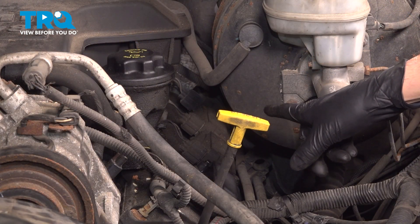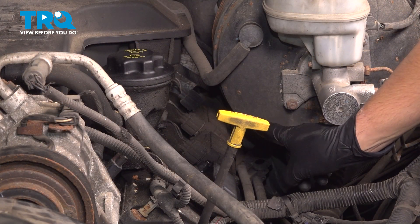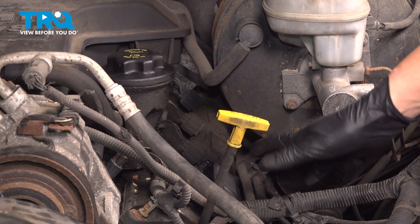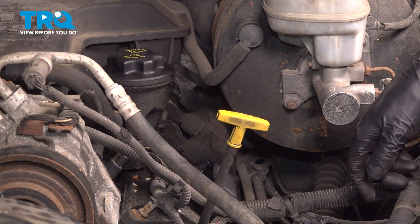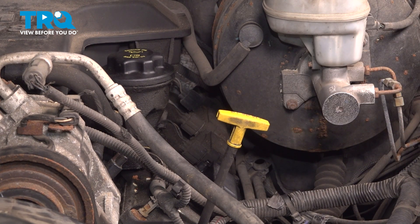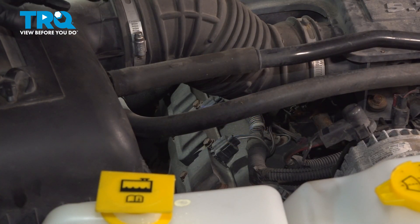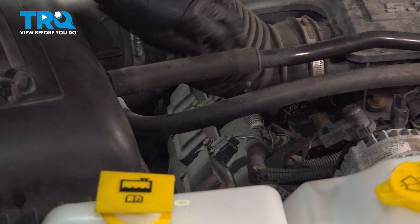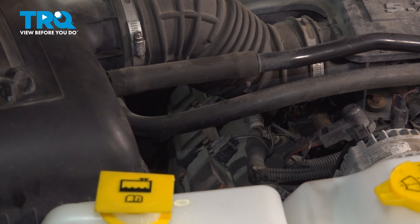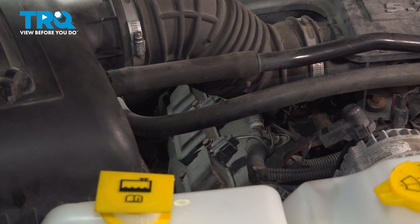On this side, it's pretty easy to access all of them except for those last one or two in the back there where you just have to reach around the brake booster — but there still is plenty of clearance. As soon as you pull the ignition coil out, just bend it out of the way. Now, on the other side, it might seem more difficult, but it's actually not. All you have to do is just reach around these hoses, the intake snorkel here, and then in the back you're going to have some wires that you can just move out of the way. You don't actually have to take off any other components to get to these.